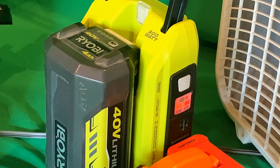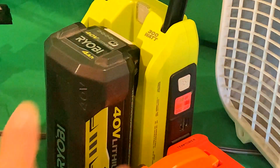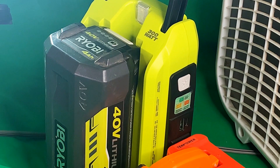That gives a little perspective on the issue it's having. It's not coming back on even after I turned off the fan — it's staying offline. Let's see what happens if we hit the button — will it come back on? There it is — our lights came back on and we're running below 2 amps. So we had to reset it. It trips, which is good — it has a solid fail-safe so it won't overheat and potentially create a fire hazard.